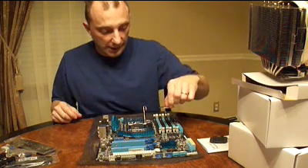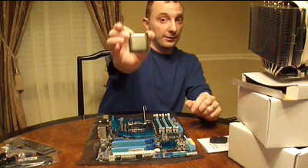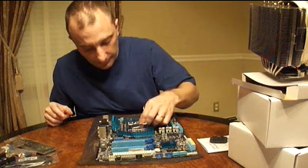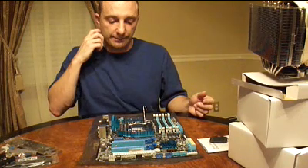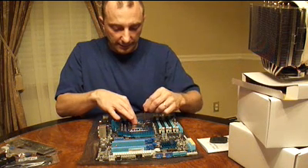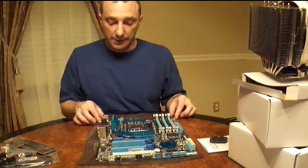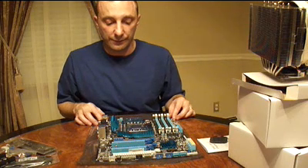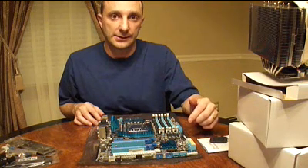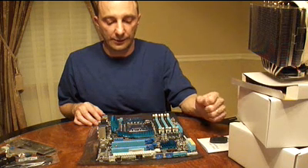The CPU is notched and there's also an arrow on the bottom right of the chip if you're holding it the right way. So you just drop that in right into the socket area — you'll see the notches kind of line up and it just sits there. Then you drive the plate back down and the lever on top of it, push it down and lock it in. And that's it, the chip's in. The manual will tell you to put the motherboard in first and then drop this in, but it also mentions that if you're using a non-stock cooling system that may require a bracket on the back of the motherboard, you may have to do this first before dropping it in your case.